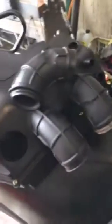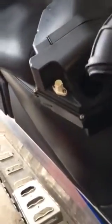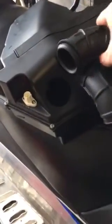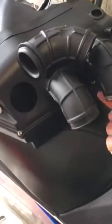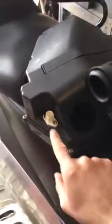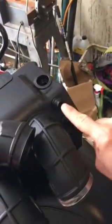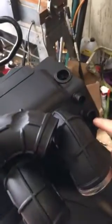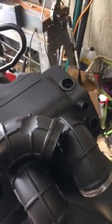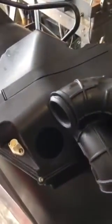You have to pull your air box out. Over here on my seat of the sled is the air box. These are your three intake tubes — one of them popped off but it should snap right back in. They're secured to the carbs with hose clamps, so you have to loosen your hose clamps. There's an air temperature sensor right here that you have to disconnect, and also pop off three hoses going to your air box — those just slide out.